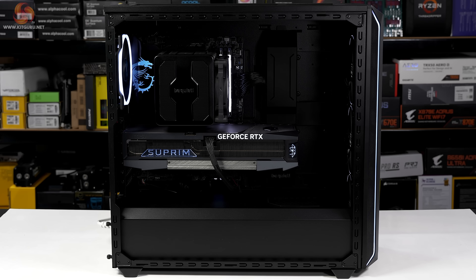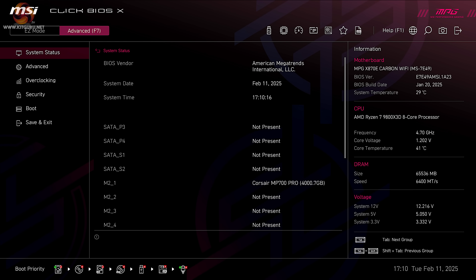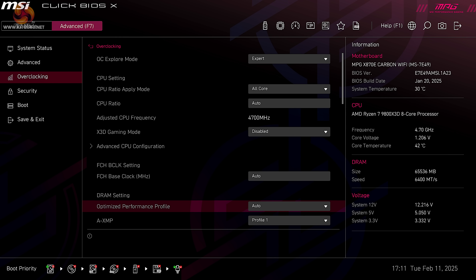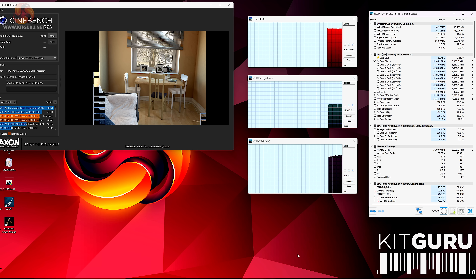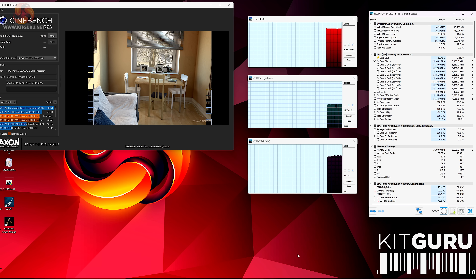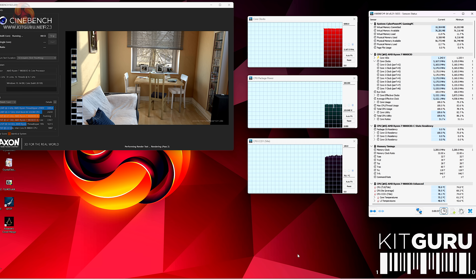The build quality of the CyberPower is absolutely fine and cable management is neat and tidy. CyberPower has installed the latest BIOS on the MSI motherboard and made a handful of small changes within the settings: Expo is enabled so the memory is running at its correct speed, expert mode has been engaged, and fan curves have been set. The consequence is the Ryzen 7 9800X 3D is drawing 150 watts under load rather than 120 watts, and while this barely affects clock speed, we have to assume CyberPower has done this to enhance performance.